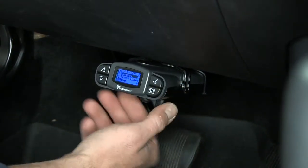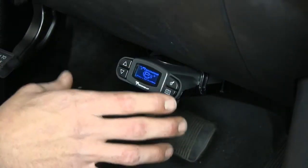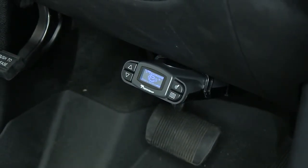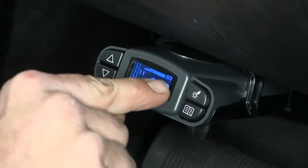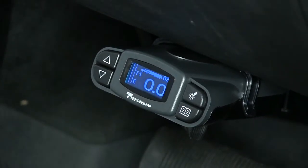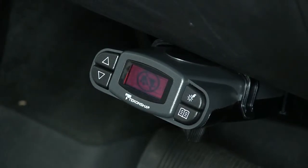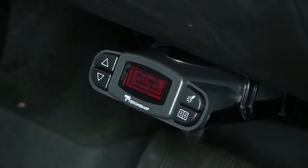We've got our trailer hooked up and we're going to be ready to go. Another great thing about the P3 — right now we don't have any trailers connected, so we've just got the beginning screen here. As soon as I make a connection at the rear side, you're going to see that it's indicated for us. You can see our screen changes now — we've got indicated right here a truck with a trailer on it, so we're going to know that it's ready for use and our trailer's connected. Another great thing is the built-in diagnostic system: if we're to lose connection or have some kind of a fault, you can see we're going to get the flash — 'No trailer connected' — indicating that you've got some kind of issue that needs to be addressed.